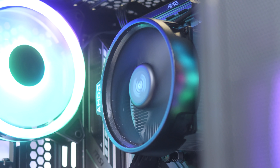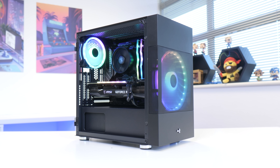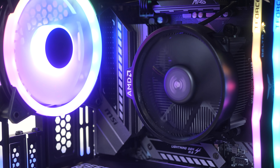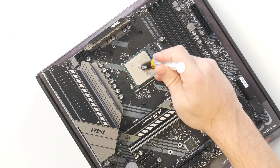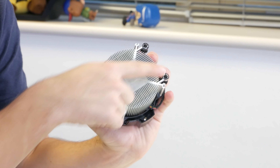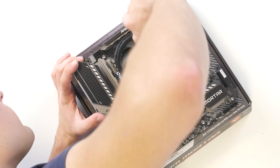To install this we need to remove these black plastic brackets which are held on with these four silver screws. That's going to reveal four little black posts — that's the back plate and that's going to stay exactly where it is. If your CPU cooler is brand new it will have thermal paste already pre-applied, but because I've used this cooler before, a little dab of thermal paste no bigger than a grain of rice needs to go on our processor first. We're then going to use the four screws on our CPU cooler to secure it through the back plate holes. It's a good idea to screw each post in a little bit before going around and tightening them all up in a cross pattern.